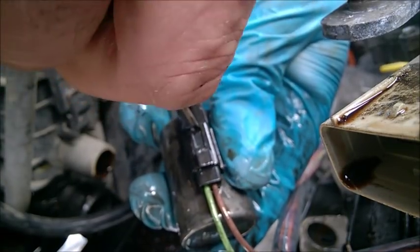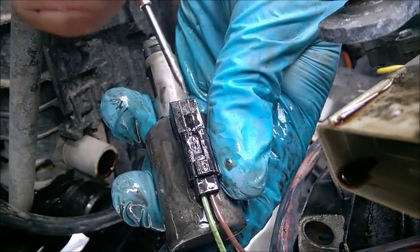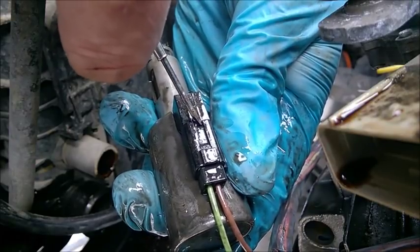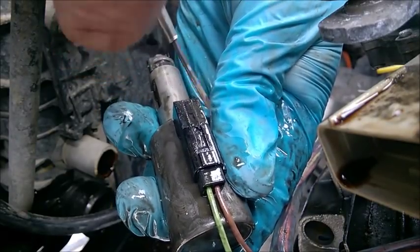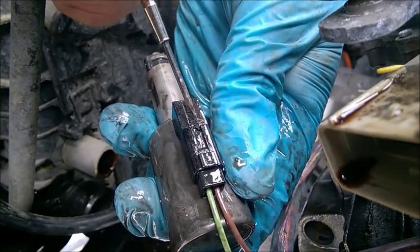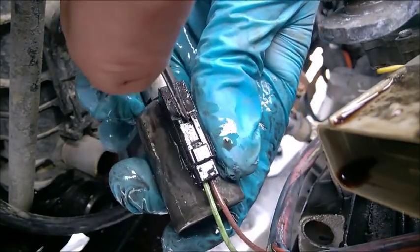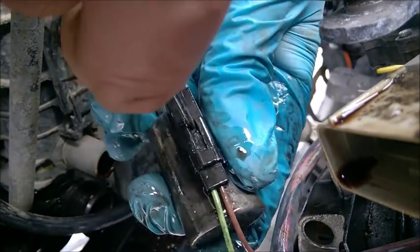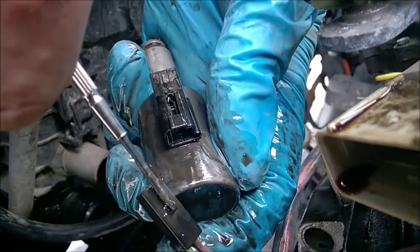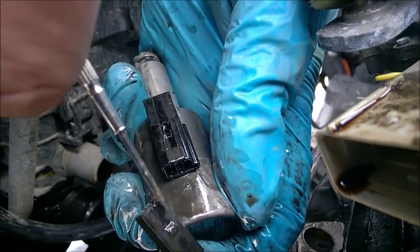Then insert the screwdriver here, there's a tiny hole. Insert it on the side, because you have the two connectors here, the two metal parts of the connectors, and you don't want to break those. So don't insert it flat like this; turn it 90 degrees, insert it in that small hole, and try to pry out the part. Now it comes out because I crushed the bump a little bit, but when it's not crushed it doesn't come out like this, it's too hard.